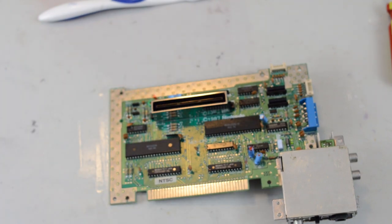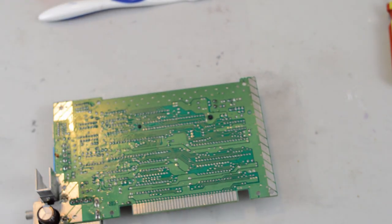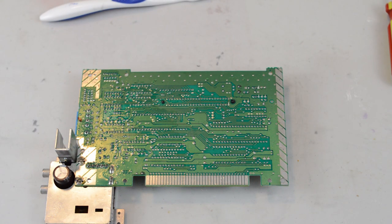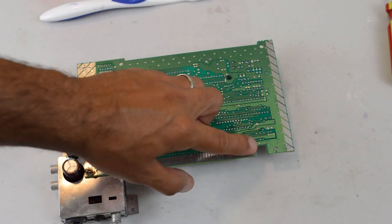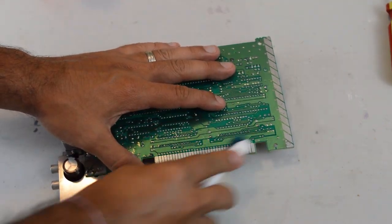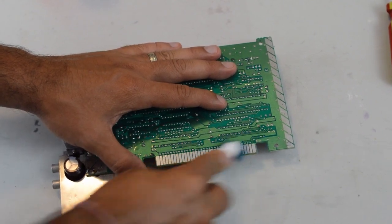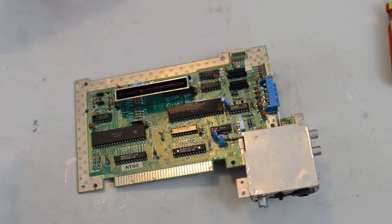After our once-over with the alcohol, I am really surprised — this board is in actually really nice shape. It's one of the nicer NES boards I've found, so it's actually pretty surprising that this NES isn't in working order. Before we move on to the WD-40, we're going to give a little bit more attention to the pin connector here, because you want to make sure it's really nice and clean. I'm going to give another shot of alcohol, but this time using the toothbrush to give it a more specific and in-depth clean, since this is the section that will be contacting the cartridge.